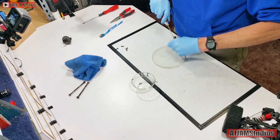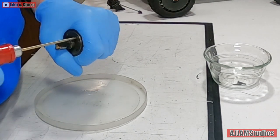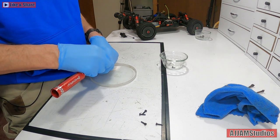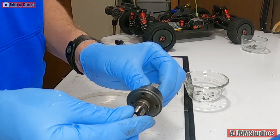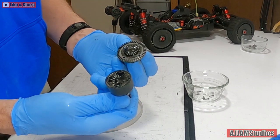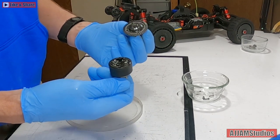We're going to get oil in that and I don't want to bathe all my bolts in oil. Now to open this it's pretty simple - keep the belt down and just pop the top off. There we go. You'll see the lubrication that's in there - this one was filled pretty good. We're going to drain it a little bit. I'm going to jam an earplug in there. I want this one pretty stiff but I'm going to leave some of the oil in it - it does give it the chance to give if the car hits funny, allowing it to slip instead of breaking parts.